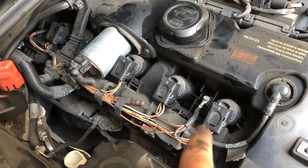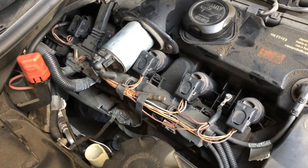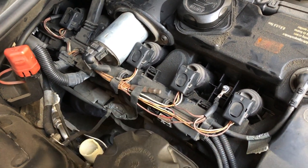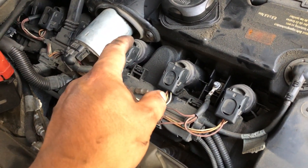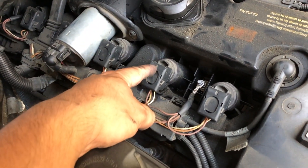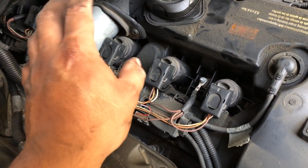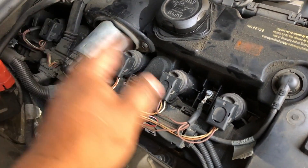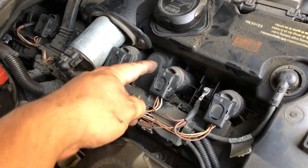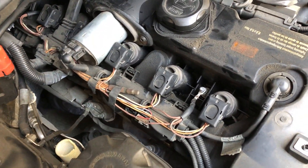It's something simple, but if you know what you're looking for you'll find it. So I changed the spark plugs and I'm going to change the coil and then I should be good to go. I could change one coil or I can change all of them. I'm going to buy it at the dealership — I'm pretty sure these are like a hundred dollars a coil, so that'd be 600 bucks for all six. But I'm gonna go buy it and see how much it is.